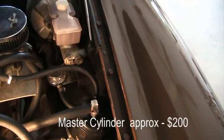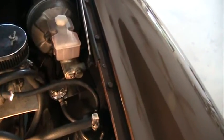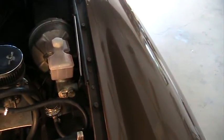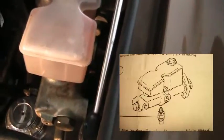What I'm trying to get across is there is a peculiar thing you've got to be sure to do when you work on this master cylinder. There is a little sender unit that goes in the side of your master cylinder. You can't quite see it here — right down in there, right at the end of my finger. It sticks out there and has electrical contact going to it indicating that it's being actuated.